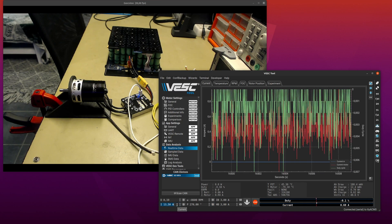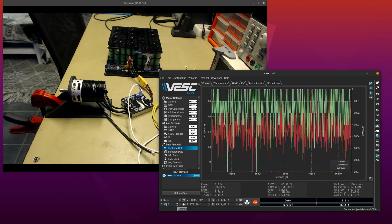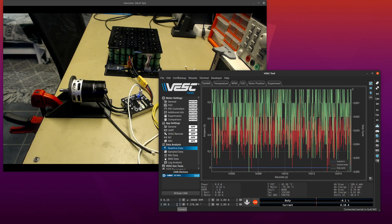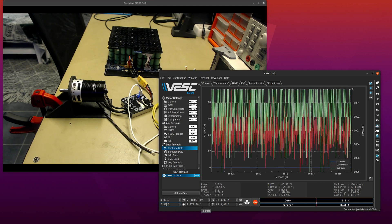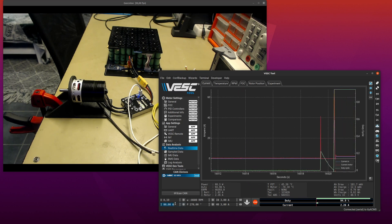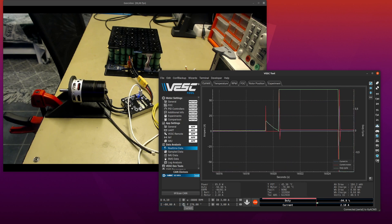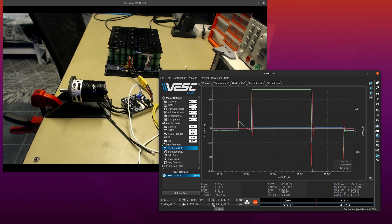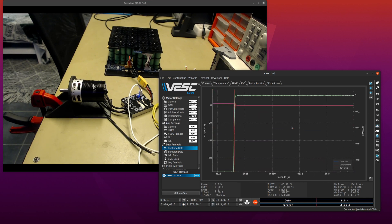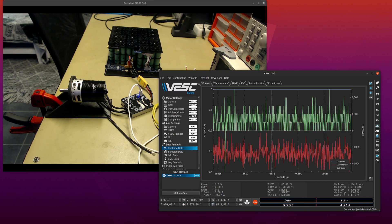Let's give it 80 amps current, then doing minus 80 amps going through zero, going from full speed in reverse to zero, back to this position, and see if we can get back to where we started — and perfect. We also got the fault code there again, but that will be fixed soon. It shouldn't be a problem if you run less than 80 amps; I've only seen it when running really high currents with the motor unloaded so it accelerates fast.